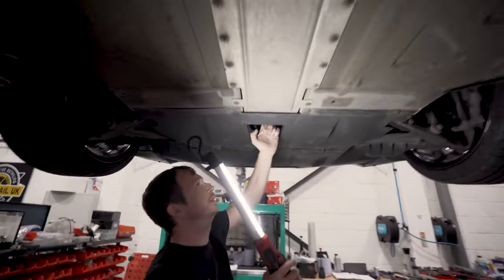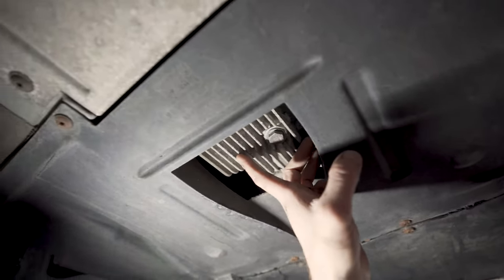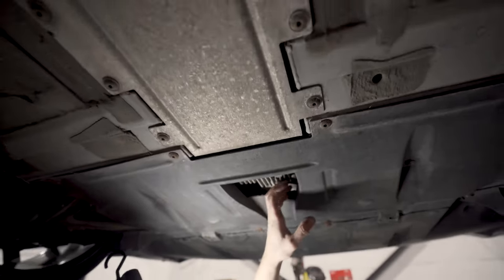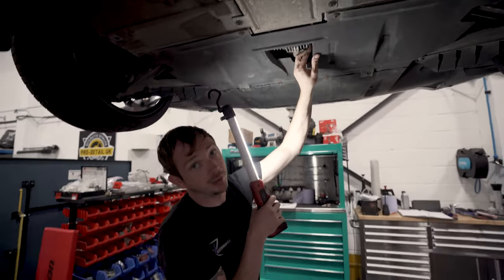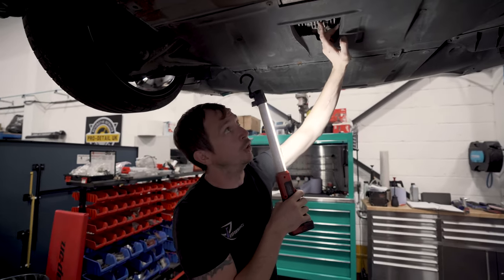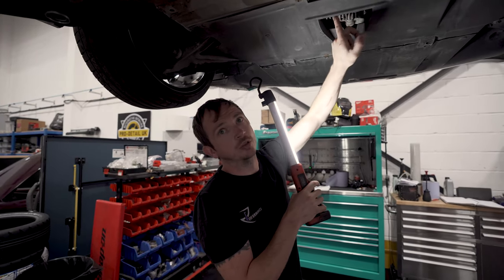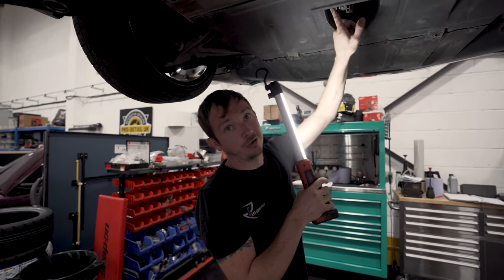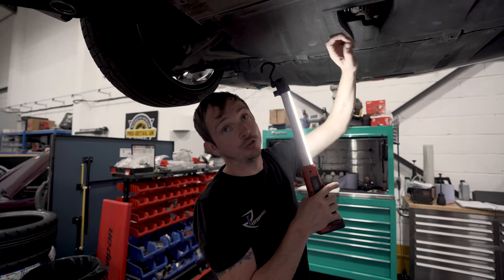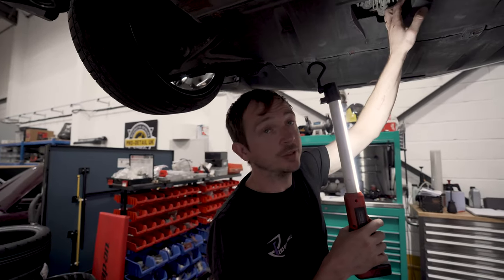Front diff lives under here. So gearbox oils every 4 years, diff oils every 4 years. So you need to take this cover off and this cover off. Check them over. If you put your car on a dyno, make sure it's a mechanically linked or an electronically linked four-wheel drive dyno. Because it's a viscous coupling that only transfers 120 newton meters of torque, if you put it on a crap dyno, you'll blow the front diff up. You'll basically melt the viscous coupling and you'll have a two-wheel drive car and you'll never know it until it's a rainy day in December and your car swaps ends.